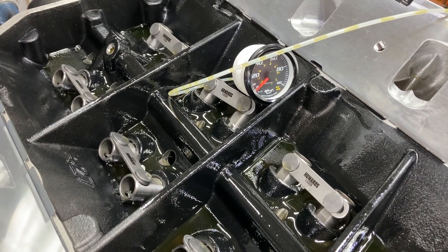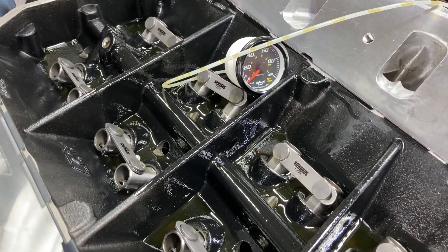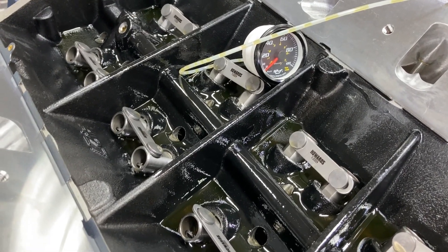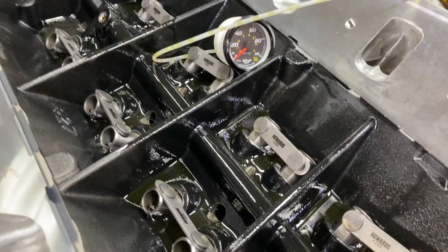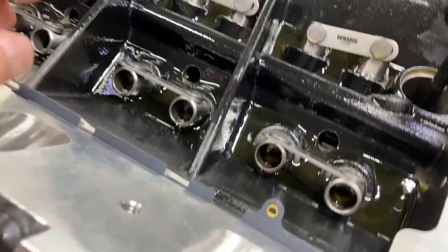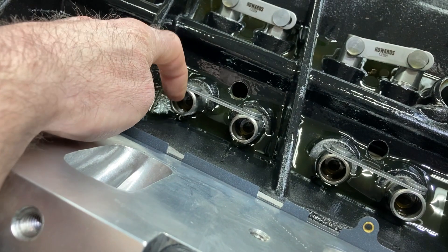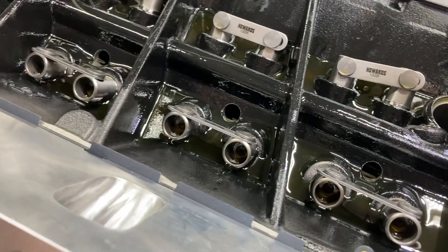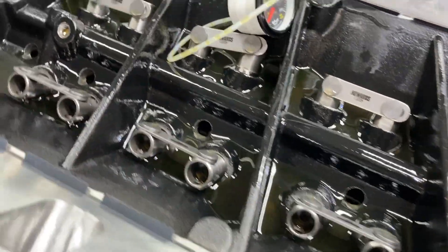I want to see generally at least 70 PSI of oil pressure on the gauge. I have run into problems in the past where that did not show and I went looking for an internal leak or something else and was able to find it. So this is a really good step to take before you put the intake manifold on — just prime the pump, make sure everything's good, make sure the pump works and everything, and save yourself some trouble if something's not right. I have found hydraulic lifters where there was no metering orifice in those, and as soon as I started priming there was just a fountain of oil shooting up — those are all things that we want to double check.